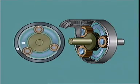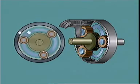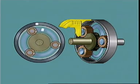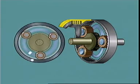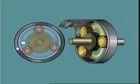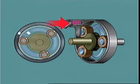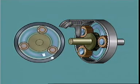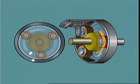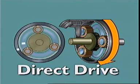A direct drive or top gear condition with a 1-to-1 ratio is obtained by locking together any two members of the gear set. A multi-plate clutch can be used for this purpose. The outer drum and outer plates are attached to the ring gear. The inner plates and inner drum are attached to the planet carrier. When fluid under pressure is directed onto the clutch piston, the clutch plates are locked together. This locks the planet carrier to the ring gear. Now, when the sun gear is rotated, the planet gears can neither idle nor walk. The whole gear set turns as one unit to give a direct drive.